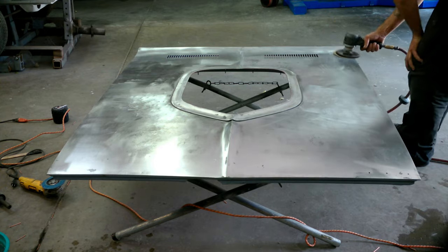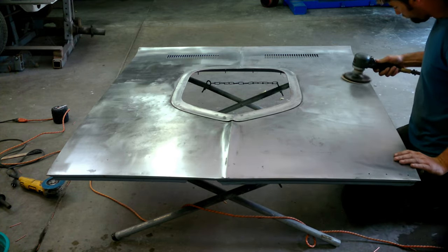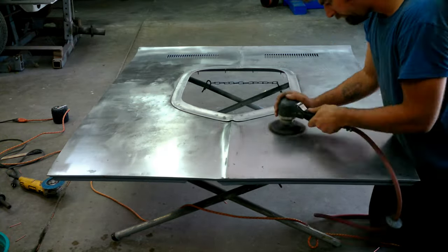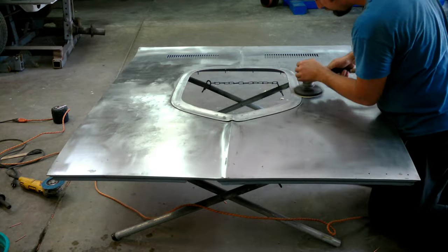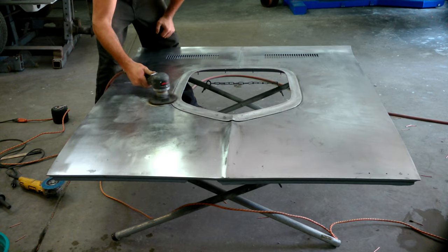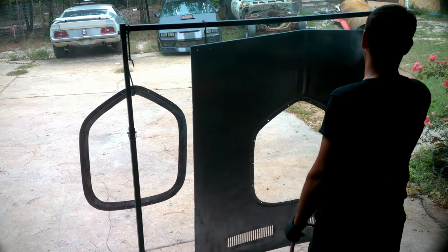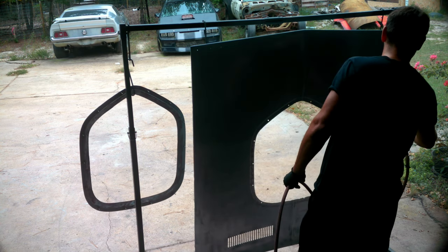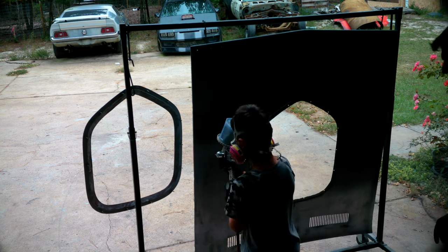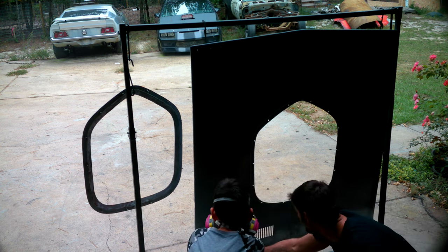The final step — now that the shaker trim ring's in, we've got to put the hood back in epoxy before we do anything else to it. DA 120 grit — that's what the epoxy calls for. I use MP170, a gray epoxy. We just prep it, clean the area up. You can see the hood's metal finish is pretty good; there are a couple ripples here or there, and there's going to be some filler on it, but all in all compared to what we started with and the amount of work put into this hood, I think it's a really good clean solid base to work off of. Here I am with the epoxy laying the final step to show you the whole process — this is what's going to finish it off in the metal stage before the bodywork. Also kind of teaching my son how to spray — he wanted to grab the spray gun and the epoxy lays down easy enough.